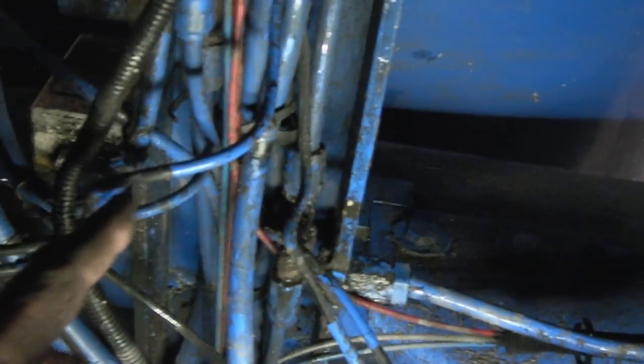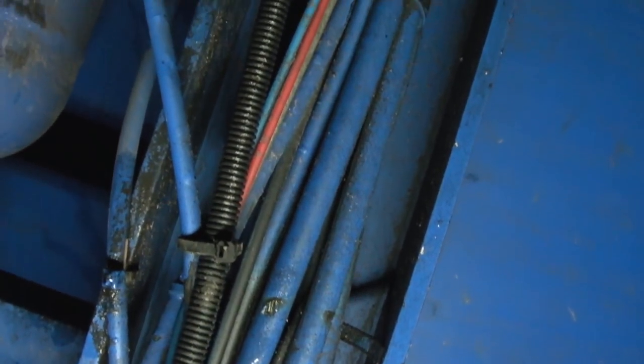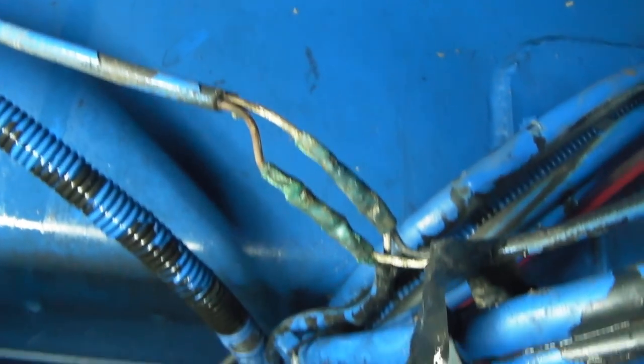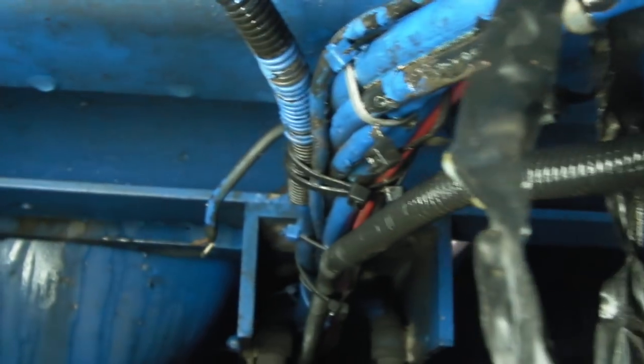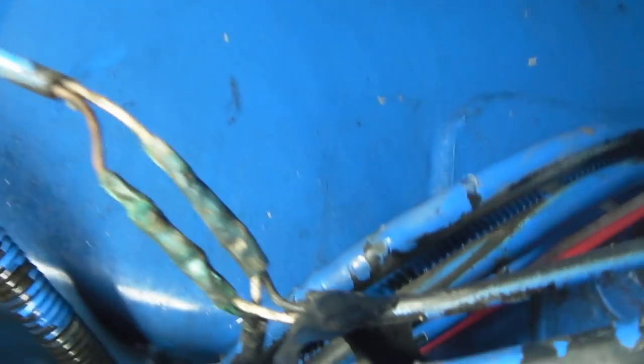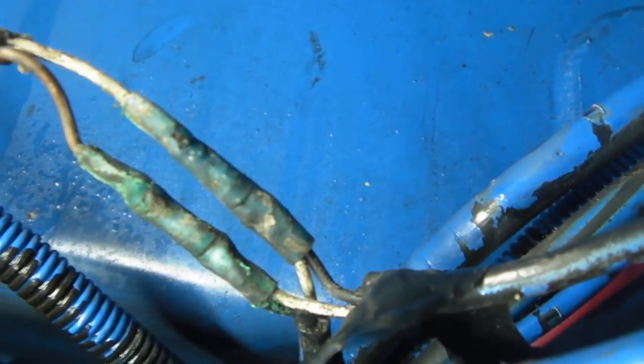This is quite a quandary because I wondered exactly what's going on first of all. The wiring is all in there to the next set of side markers, so it's quite difficult to test. This side marker here has no power and you can see the plug and it's daisy-chained. However, I followed it back and to my surprise we have green connectors again. And also I have a wire here which is severed — it's been cut deliberately.